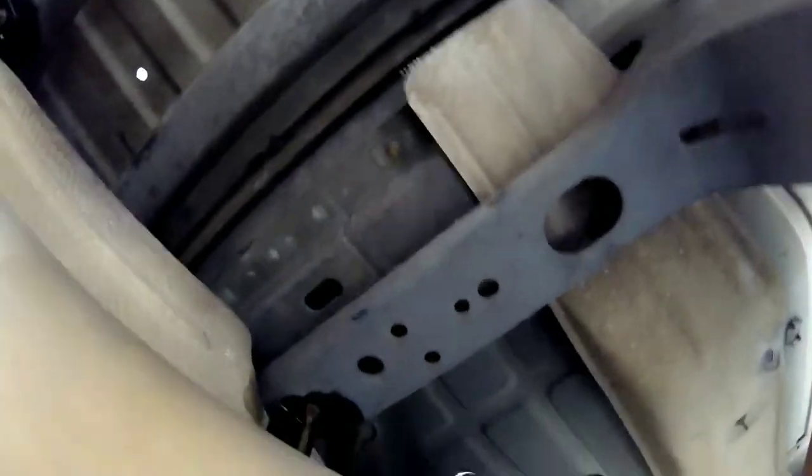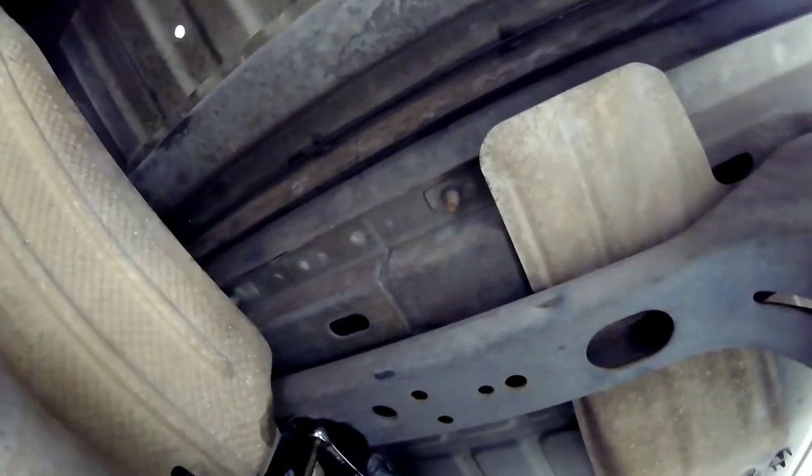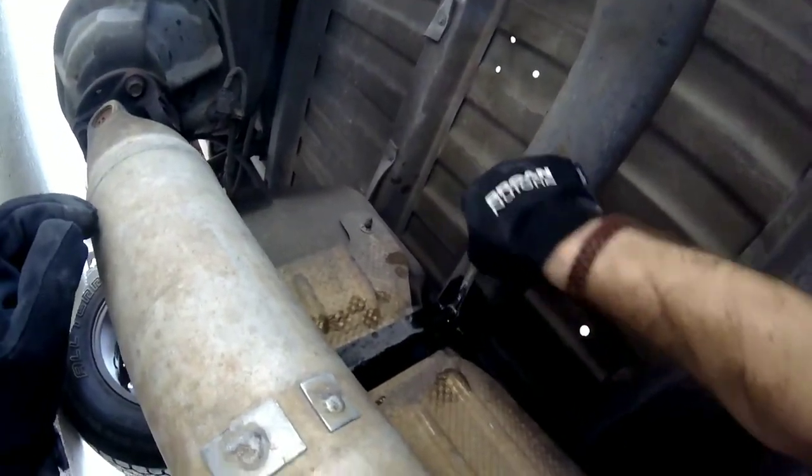Crawling up underneath this truck is not what I wanted to be doing today. We've got to break these loose — I'm using three-eighths. It's on there good. Let's go ahead and break this one loose. We're going to speed this up a little bit. I got myself a couple extensions and got crafty. You can just run that screw down as far as it'll go — down to the very second to last thread. You don't want to drop it entirely, though.